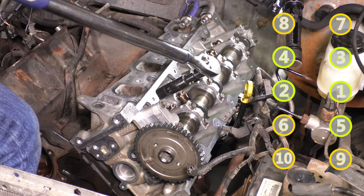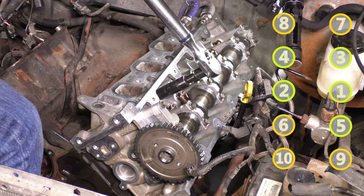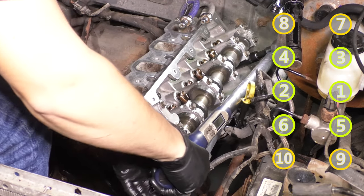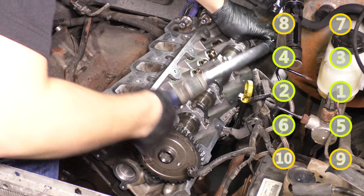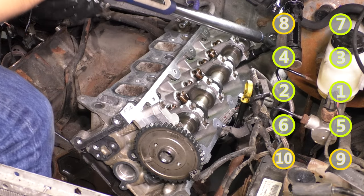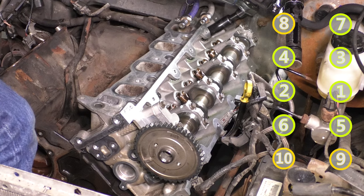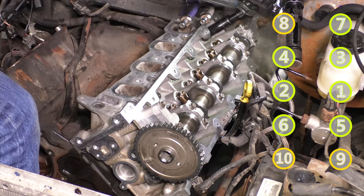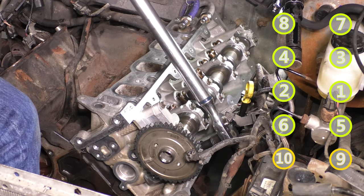My torque wrench reads degrees. However, on these bolts that it was creaking and skipping on, it actually didn't read anything. Every time it skipped, it would tighten, but the torque wrench didn't read a single degree. So I ended up having to basically eyeball the tightness of these bolts, basically judge how much the torque wrench spun in relation to the original positioning of the bolt. So I wish I marked them, but I didn't, because I thought the torque wrench would do the job for me, and it didn't. It failed me.